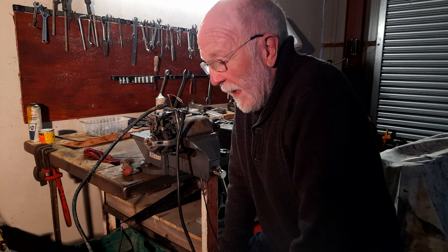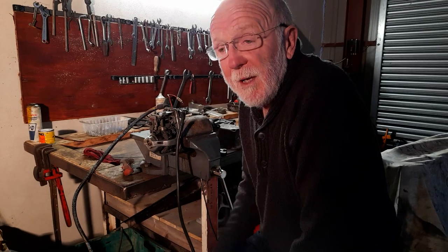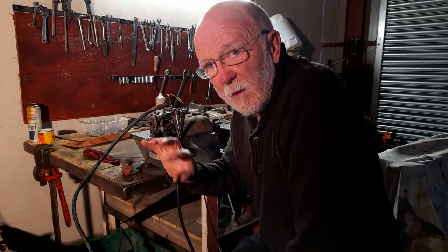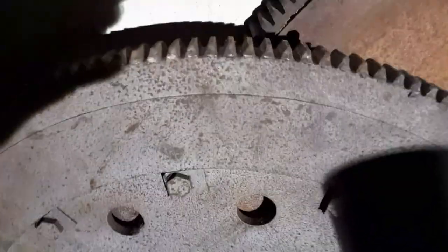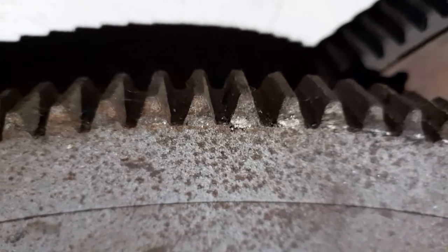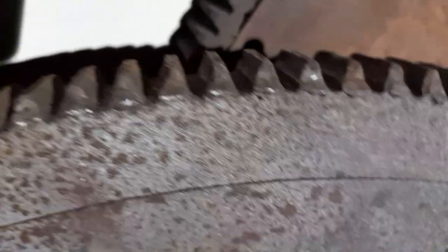On to the next scenario. It's a known fact that Gardner engines stop at the same point in the cycle every time. What happens is the ring gear on the flywheel starter ring gear becomes worn — sometimes quite significantly. You can see on this starter ring that the teeth are only worn in one short section where the starter pinion has engaged; otherwise they're not too bad at all. So if you can rotate the engine and move the point of contact with the pinion away from those worn teeth, your engine will start fine.